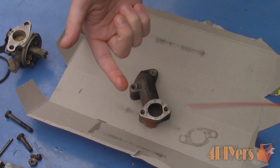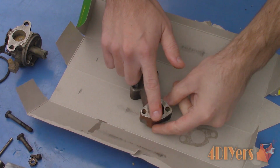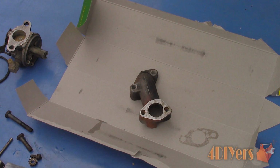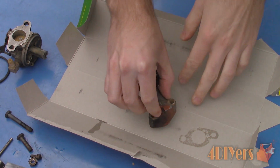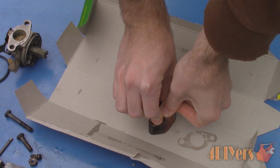This flatboard cardboard or paperboard that I referred to earlier is typically found on cereal boxes, snack packaging, or what I'm using here is from an auto parts packaging. Considering I'm working with a smaller object, I'll be using a slightly different method to cut the gasket out. But if you are working with larger objects, you can hammer out the edges with a ball peen hammer. Hopefully I'll be able to show you that version in the future.